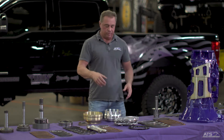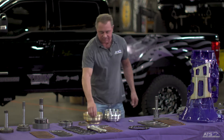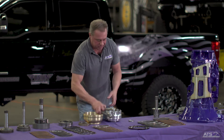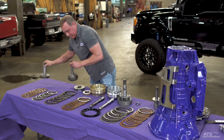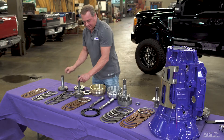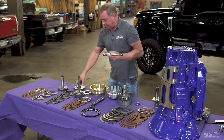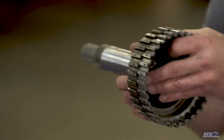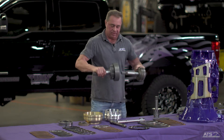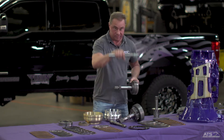Moving on to other components, we get into the shafts of the transmissions — these are the shafts we build — and of course the planetary, then the overdrive and underdrive clutch assembly. Lining these up, you have your shaft hooked to the torque converter, which hooks to the clutch drum, then to the overdrive hub and forward clutch hub, which hooks to the clutch packs and splines to the planets, and then power goes to the rear wheels.